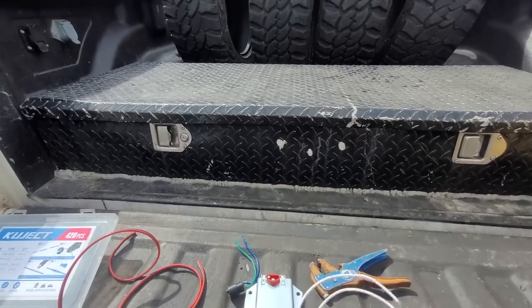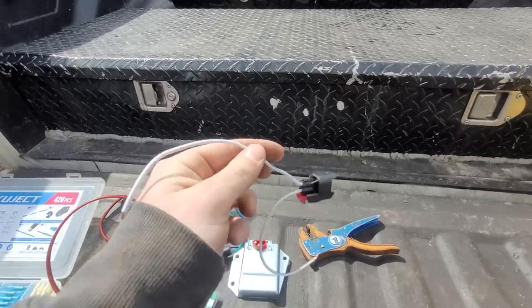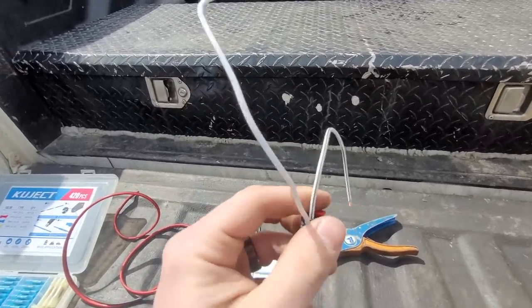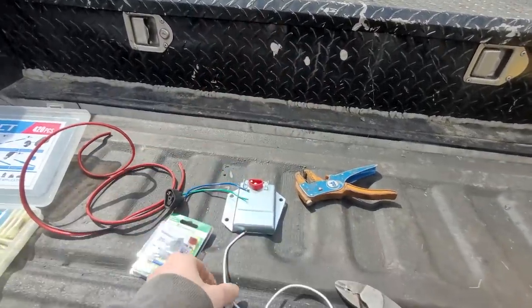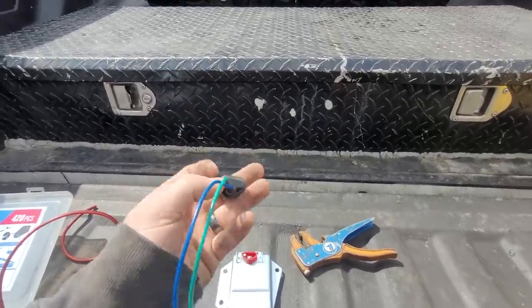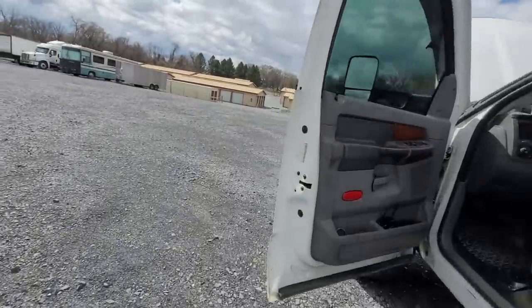On this connector I'm going to leave it empty. I'm not going to assume — I'm going to actually go through and check out the wire harness. This one here should be the positive on top, and then the one with the black wire should be the negative. This one in the middle goes to a switched power and goes to this connector. And then this one here is a ground. That one will go to that one, and then this case gets grounded. I'm going to take pictures of his engine bay.